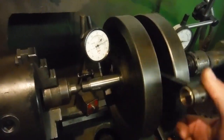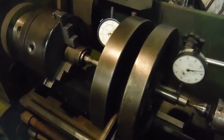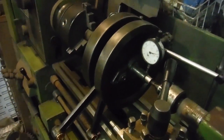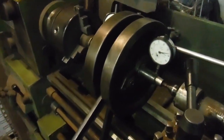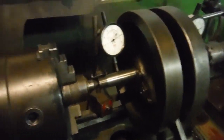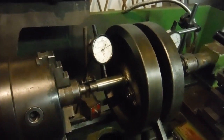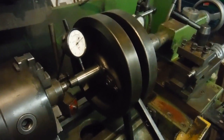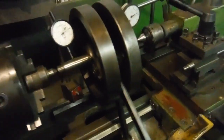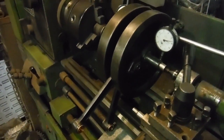I'm hoping these can go into the engine and play their part in a nicely renovated engine that'll be ready to go for many, many thousands of miles. My next stage will be to get these ready to put into one of the crankcases. I'm fine for the timing-side main bearing, but on the drive side I have a hurdle: new outer races for the crankcases aren't available, so I'll have to conjure something up to deal with some pitting. Once that's resolved, the engine can go back together and be put back into running order. That's one major headache sorted — I'm very pleased with that.